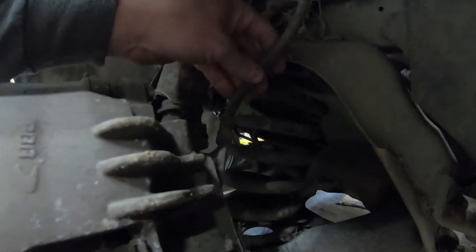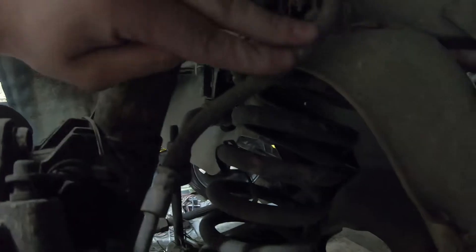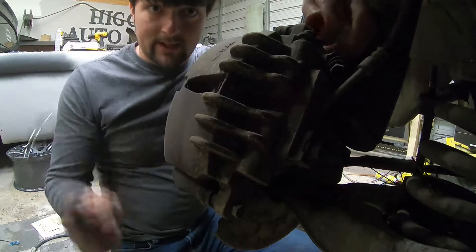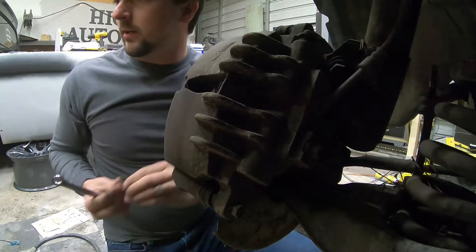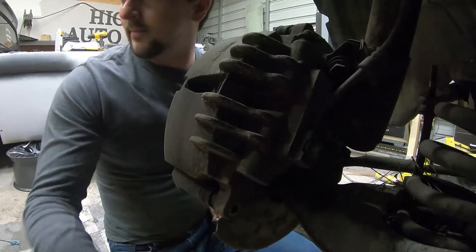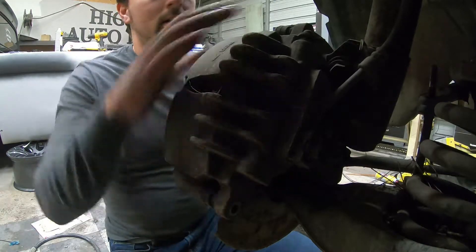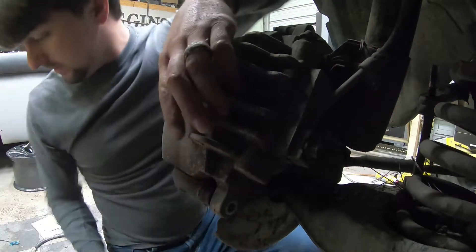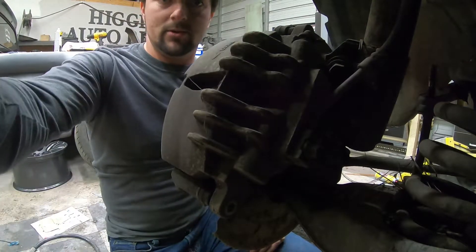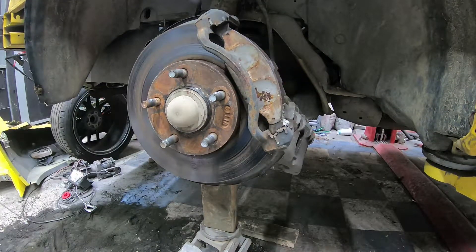You don't want to take the ABS and brake lines loose, so it's a good idea to go ahead and take the caliper bolts out and pull the caliper off so you don't have to worry about the brake line when doing this. Taking the caliper off right now is probably the best idea — and go ahead and change out those brakes if they need it. In this car's case the brakes are good in the front, so the caliper's loose and I can go ahead and pull it off. Once the caliper is off, I'll get up on top and get those strut bolts loose. Jack up to take the tension off the top of the strut, then take that last strut bolt loose.